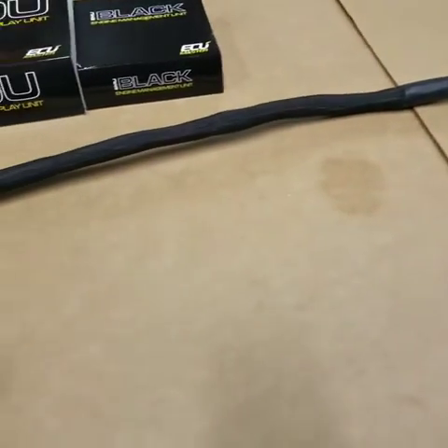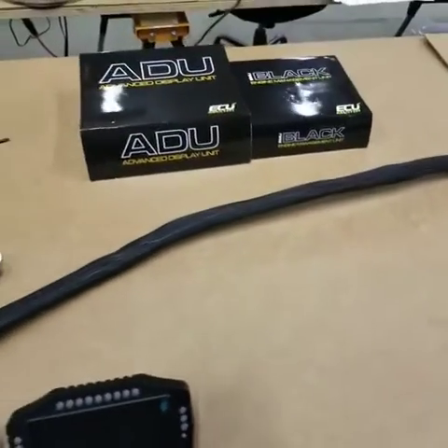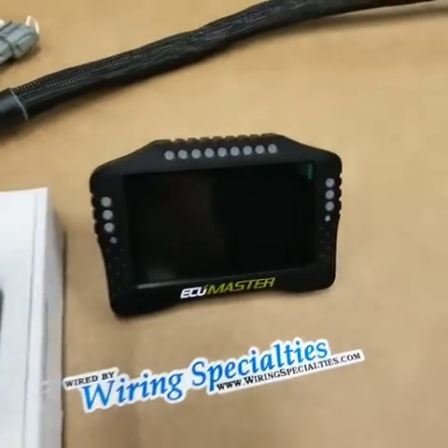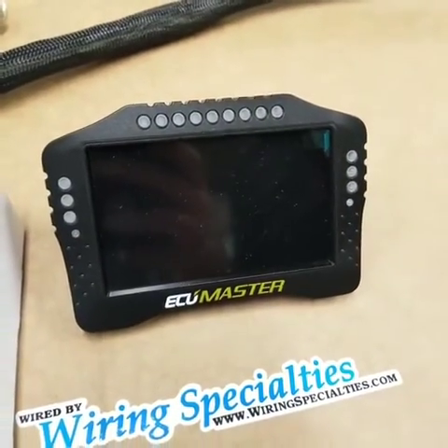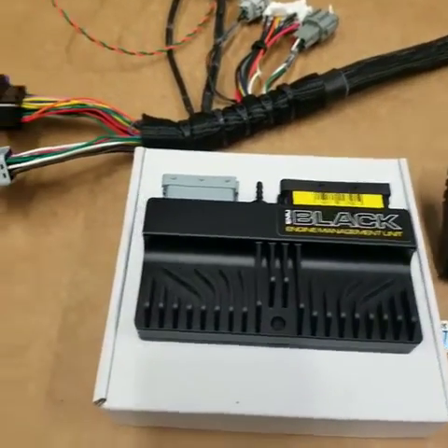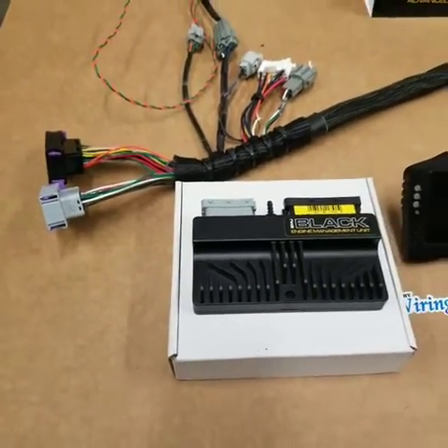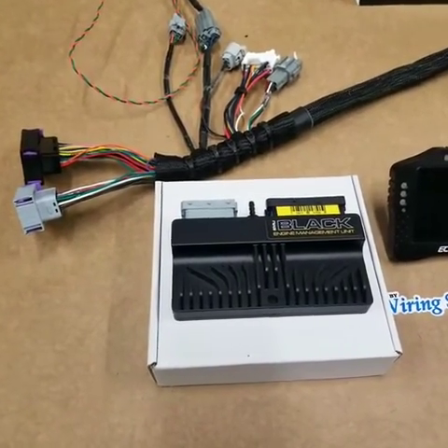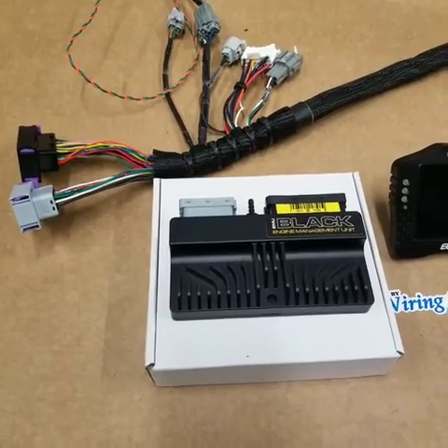There are a lot of nice protection features, and if the ECU is capable, you can send data directly to the dash — like this ECU Master 5 display. It's two wires, so it'll transmit all the data including lambda, alcohol content, throttle position, and boost pressure — everything will show up on the dash.